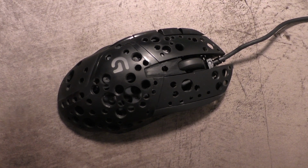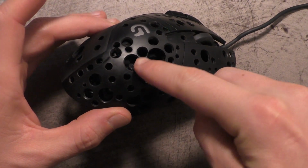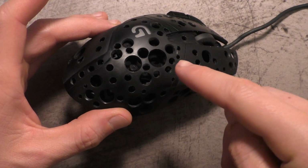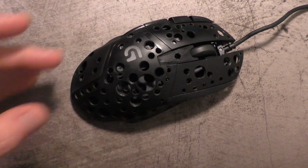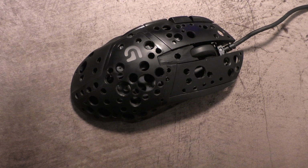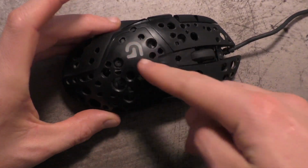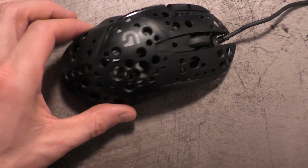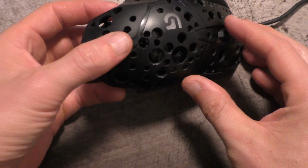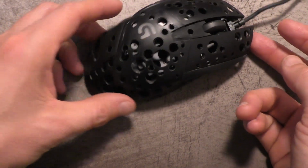So a couple things, I forgot to do this until after I assembled it. All the little ridges that came up, the roughness from drilling into it, were really uncomfortable. So I had to go back with sandpaper when it was still assembled. I'd recommend starting with a 400 grit or 600 grit. You can get those grits at an automotive supply store. It actually makes the finish more matte, and I think it makes the way it feels nicer too. And if you drill holes onto this glossy strip here, you're going to need to sand that too. So you sand that down and make it all matte.